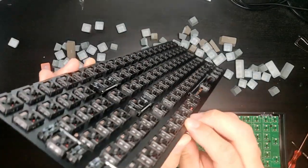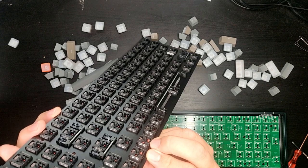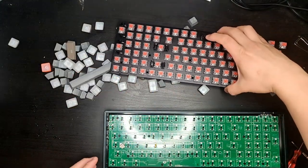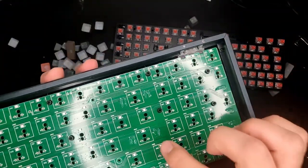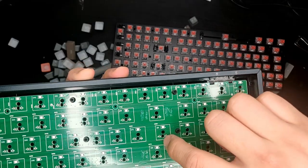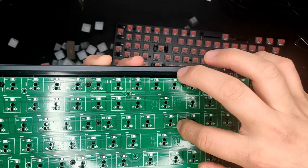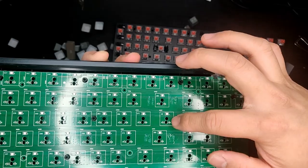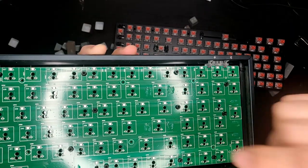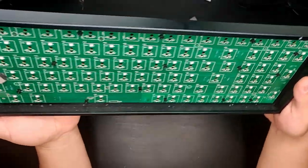Oh, check this out. So this is how it works. There's the switch housing, just as it pushes down, this plunger kind of closes off this little opening here. And on the keyboard, there are these little LEDs. This is labeled as IR, and this is labeled PT. So what I think how it works is this: the infrared beam activates on the right, and it shoots across to be received on the left receiver. And when you push this key switch down, it interrupts the beam and registers the key press. Okay, so